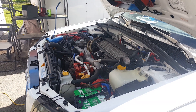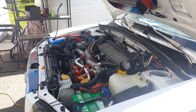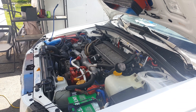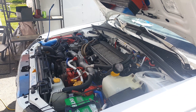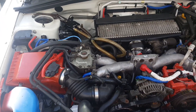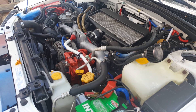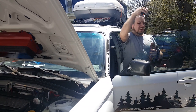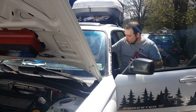It sounds good! I think because we drained the fuel out it's probably lagging. We had a fault code stored in the ECU that was preventing it from starting. The fault code was for the crank position sensor, so I cleared the fault code.